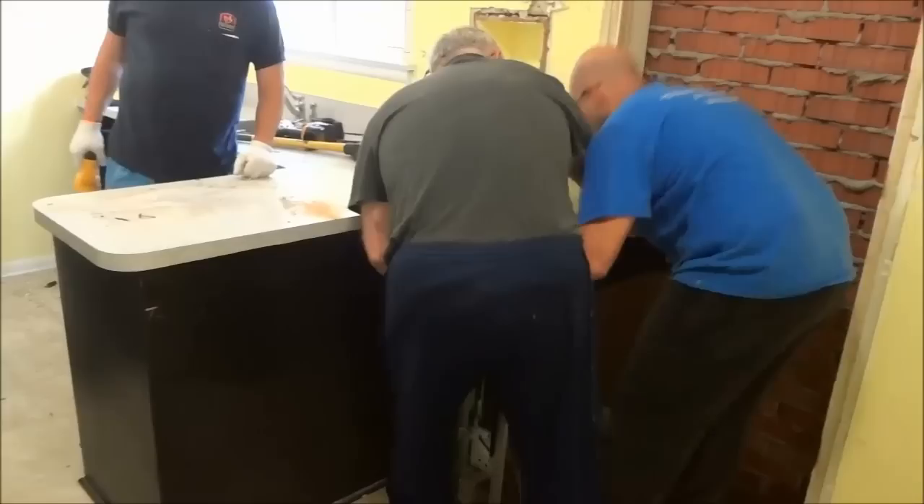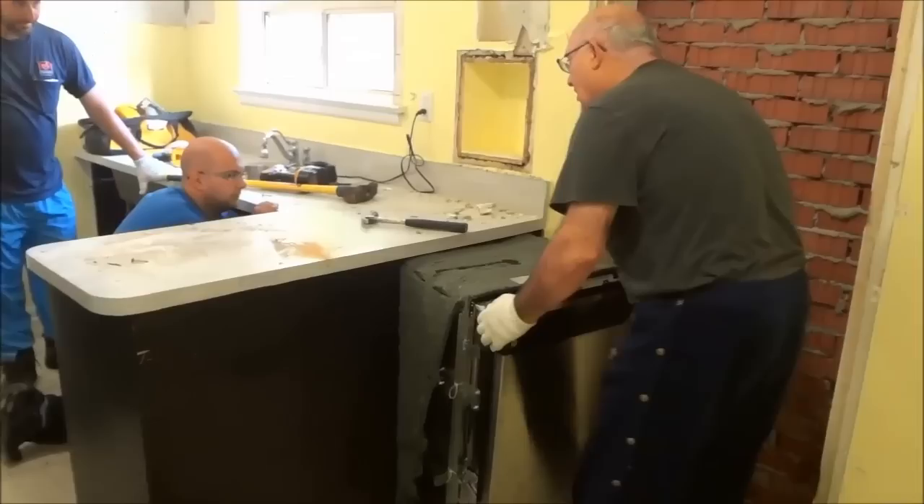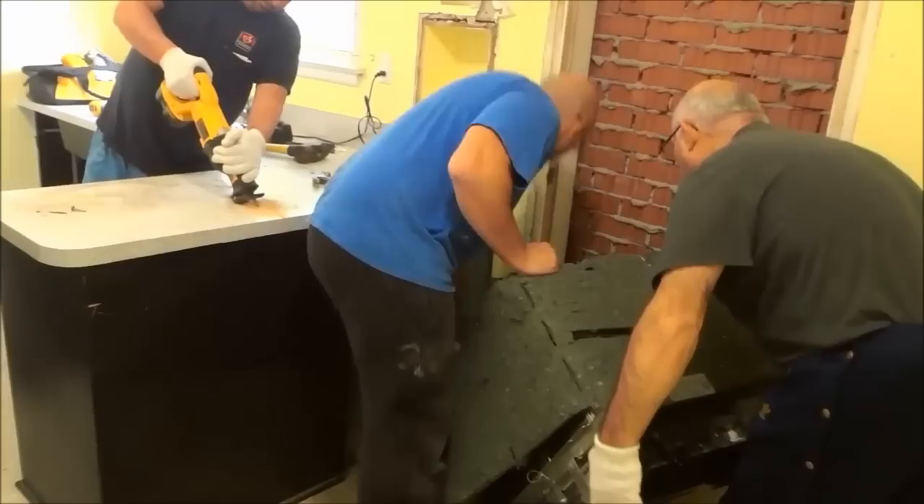After lowering the legs I was able to remove the dishwasher. I was doing a kitchen renovation and it was really loud in the kitchen, so I had to do a voiceover for this part of the video. You can see that I went to the other side of the cabinet to push in the drainage hose, which was caught on the cabinet. Just make sure the drainage hose is completely free and clear when you are removing the dishwasher and you should be good to go. Thanks for watching.